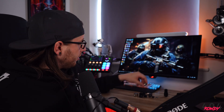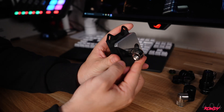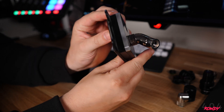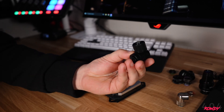There are other types of 90-degree fittings that can make life even easier depending on your application. This one is a 90-degree rotational fitting with two ends to adjust — not only can you rotate the fitting entirely, you can also rotate the tip to give a slightly different angle that could be very difficult to achieve with hard lining or soft tubing. You don't tend to need these a lot, but I've had to use them mostly for hard lining loops. Bear in mind that every time you buy one of these you'll also need a fitting for the end of it, which racks the bill up quickly.